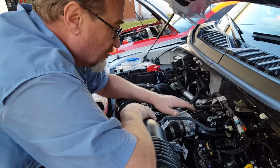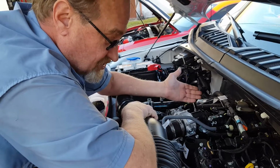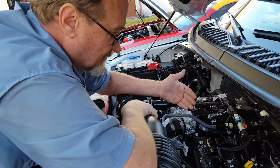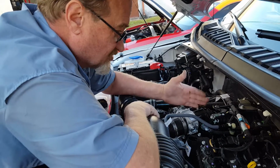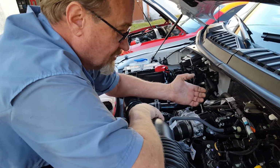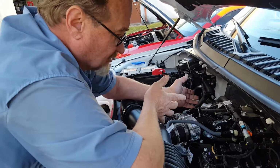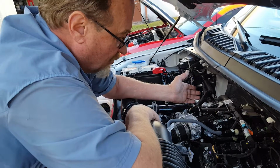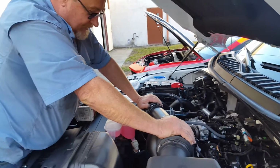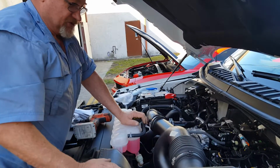And we're also going to increase fuel economy because there's going to be less knock retard, which is the computer, the ECU, pulling timing to address detonation. As we remove those compounds that cause detonation, the computer will keep your engine timing advance at optimum levels. So the engine runs better, a little bit more power, a 1 to 3 miles per gallon improvement in fuel economy, and we're eliminating most of the issues that cause premature wear and damage.